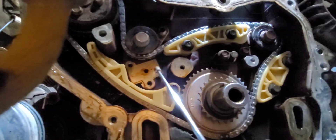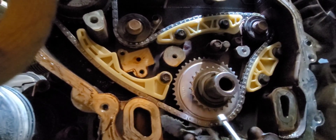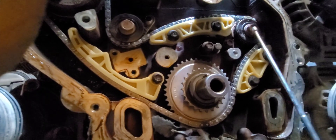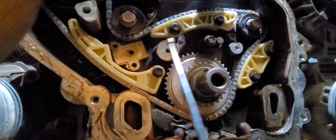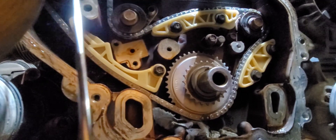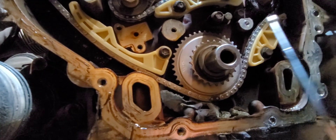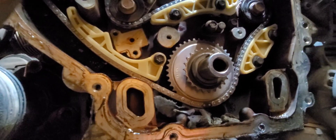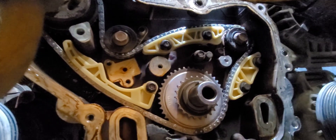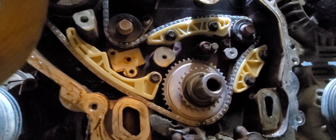Now, same thing goes for the timing chain, but it'll come a little bit later for us. I don't have the tensioner on yet, so you guys can do this however you want. The quickest way I've found — start with this one, work your way around. I leave all the guides off, hang it on the water pump, and roughly line it up. Then I start here, here, and here with the guides, and then I put the tensioner last. I think that's the easiest way to do it. We'll come back and show you the timing part as well.